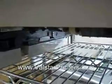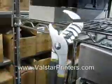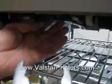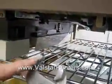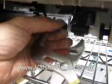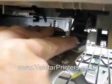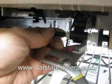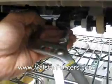Okay. Now, the secret to getting these things out easily is tongue and groove pliers. Here we've got a 6-inch set. Open it up all the way. When we do this, you're going to want to make certain that the top, which will stay flattest, goes on the end of the shaft. The other end is going to line up onto the center of the drive assembly, and light pressure is all it'll take. Push it through as far as you can get it.